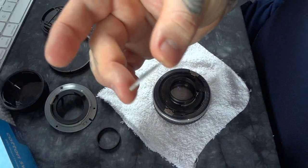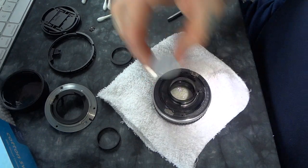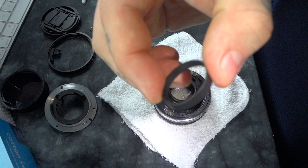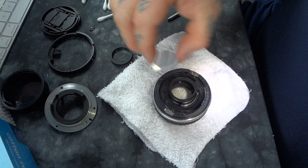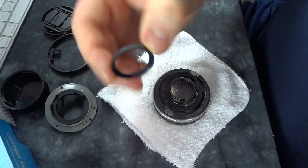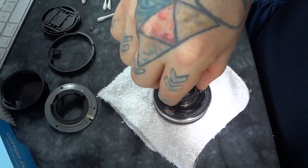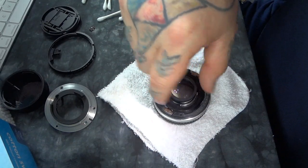Here is the actual rear element with the convex side sticking out. Before I put that in, there's a metal spacer right here — it sits right like that. Then I put the rear element in, and this is a screw cap. It goes on like this in the rear with very fine threads. I'm not going to screw it in all the way since I'm going to have to take it apart again and reassemble it.